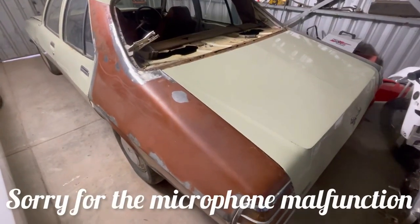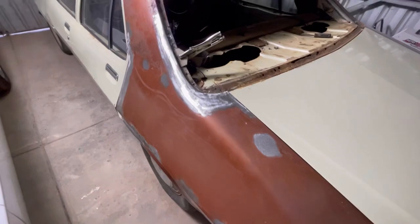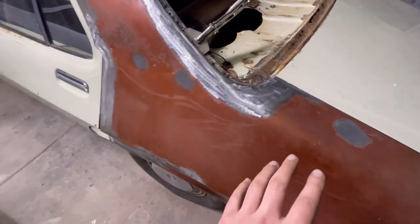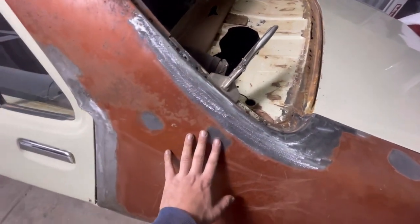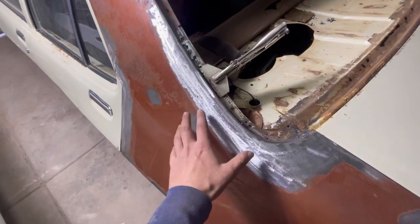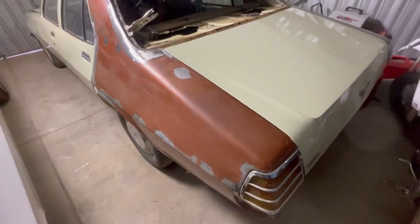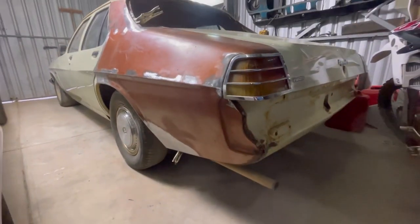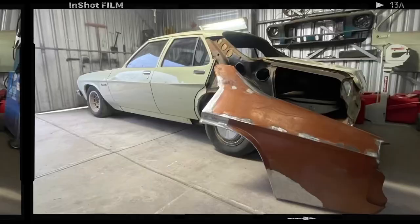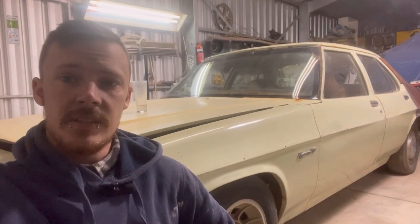The quarter panel's back on the car and I'm all packed up for the day. That's come up looking all right — not too bad, I can live with that. I have noticed the screw holding the quarter panel on here is a bit worn out so it's not really doing its job. I ended up slapping a clamp just up here and I've noticed it's pulling the quarter panel in just a little bit, which tells me the weld through here needs to be stretched a little more. Not a big deal, but I'd rather find it now. Really happy with the rest of the quarter panel so far — it's coming along. Until next time, cheers.